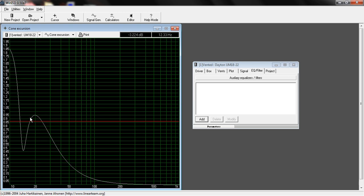Any time the curve crosses that red line, that means your subwoofer is bottoming out. This tells you what frequency it's bottoming out at. It shows that from about 17 to 24 hertz it's going to bottom out, and it'll also bottom out around 13 to 14 hertz.